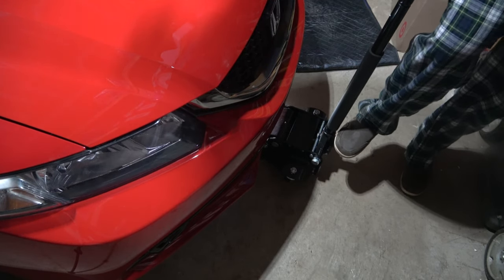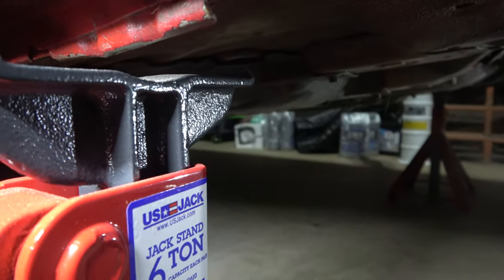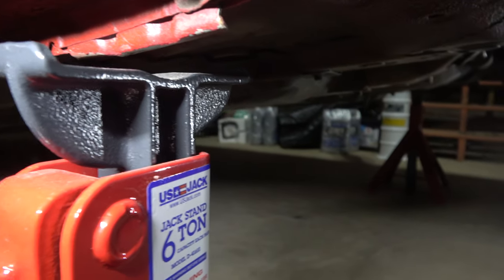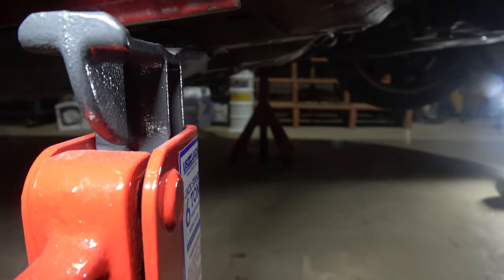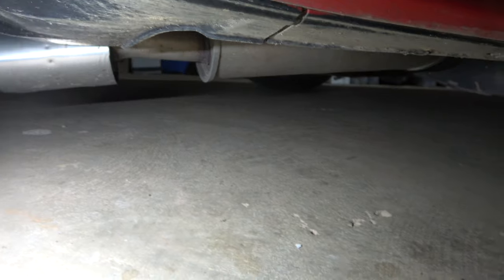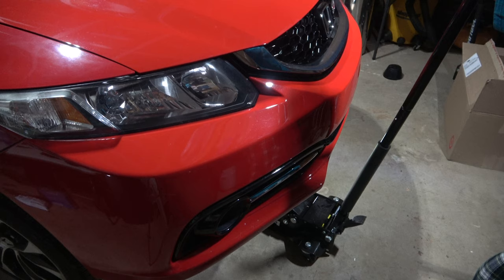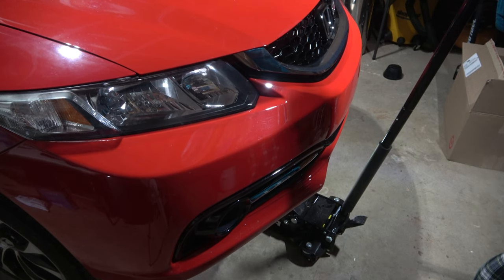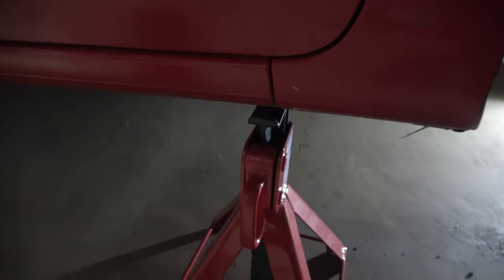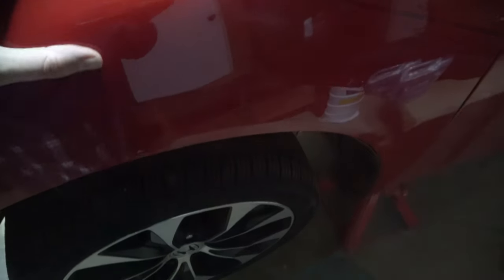You can use your foot to try to get the vehicle up as far as you can with the pedal, but then you're going to have to yank on the bar. You can see how I've angled the jack underneath those notches — the jacking points — to be above the valley of the jack. The back is already really low, so we're just going to get the front of the car on the jack stands. Now we're going to lower it nice and slow. We always check the jacks visually, make sure they're in the valleys, and we shake the car to make sure it's stationary and sitting nicely.